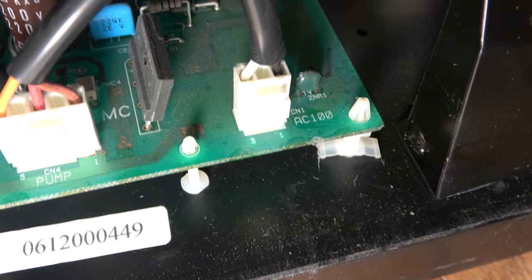Let's check that 5-volt line there. So between green and yellow, we're looking for 5 volts, if I've done everything right. One volt. Have I fitted that diode back to front? I'm thinking I might take that diode out. Okay, let's do that again with the diode removed. Look for 5 volts. 5 volts. Go up here. Ready. Looking good.